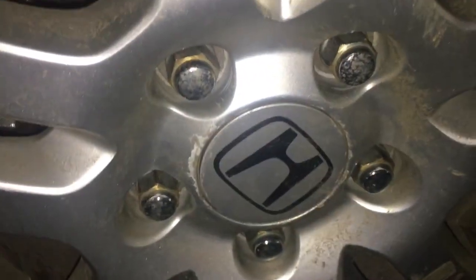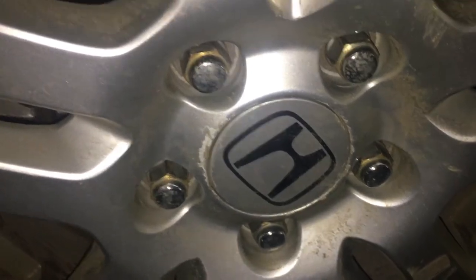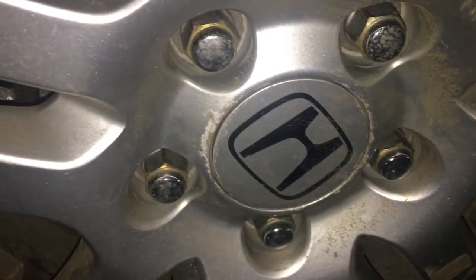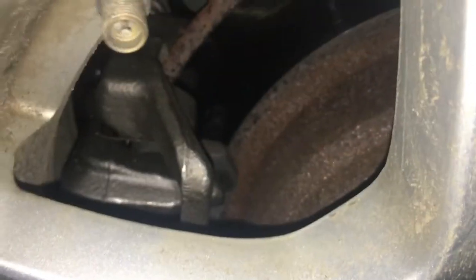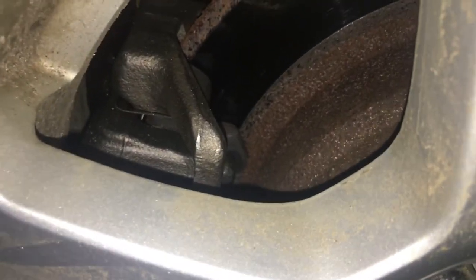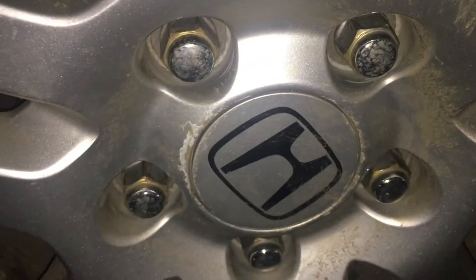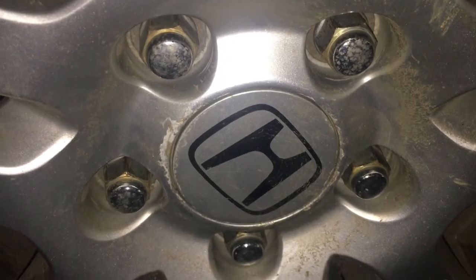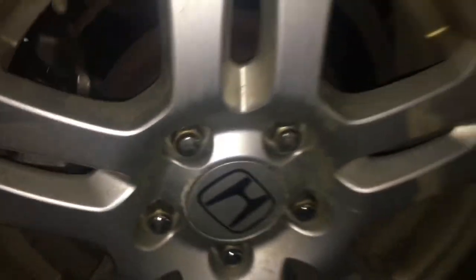I just drove into town and if it's dragging it would be hot. I'm also going to monitor this over the next couple of days — I'll get under the car when it's parked and look to make sure there's no fluid dripping from any of the connections. On the way into town I made sure it was safe, did some pretty hard stops, pumped the brakes a couple of times, and it felt great. I think this is a good fix. It probably took me about an hour to do the entire thing.